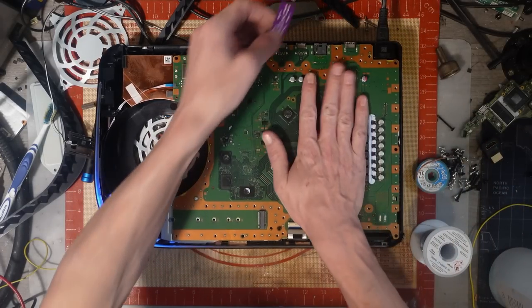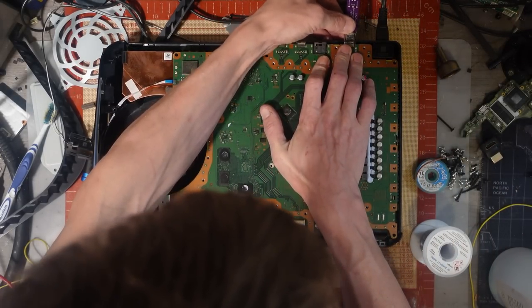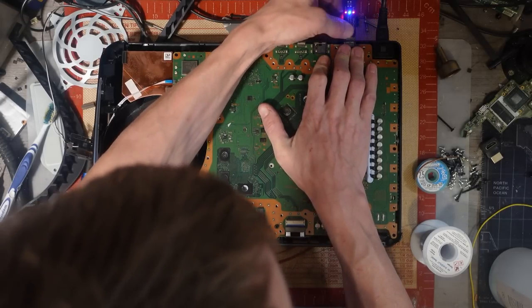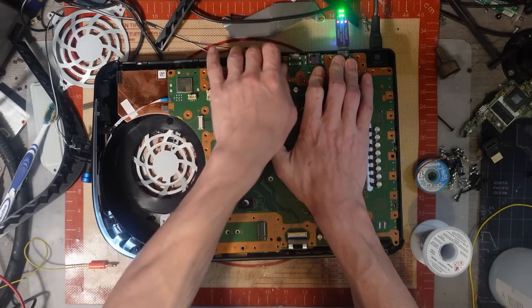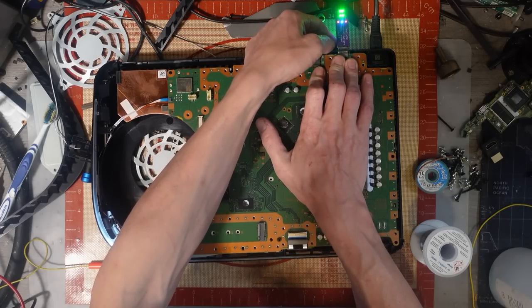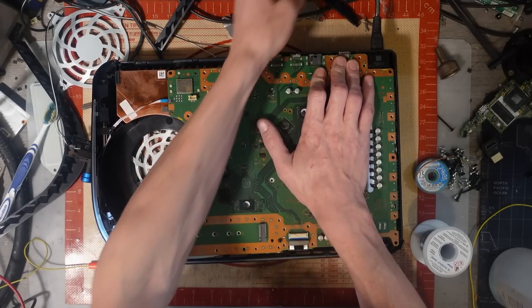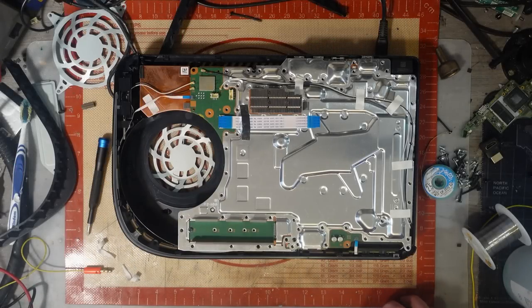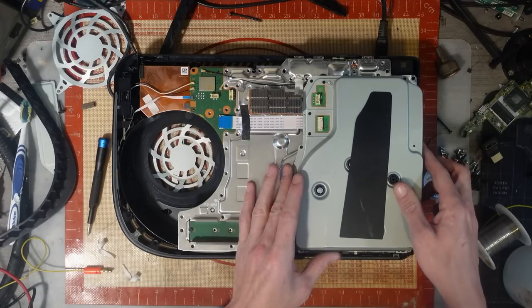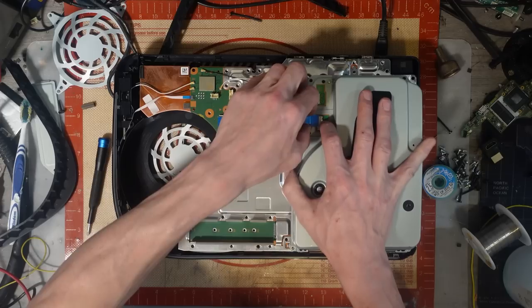And this power supply will probably be absolutely fine, but, you know, just given the fact that it's taken an impact, is it really worth using it? We have a display. So the HDMI tester's telling me we've got display, we've got a white light. That is a fixed PlayStation. So I do just need to test the disk drive real quick and just make sure that works. But I've got a feeling it's going to need to be stripped down and have some replacement parts.